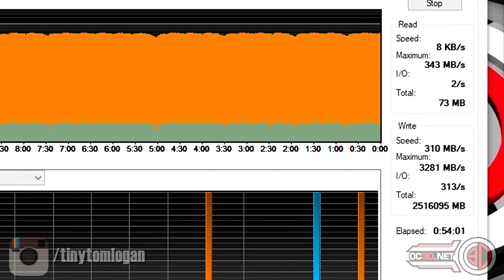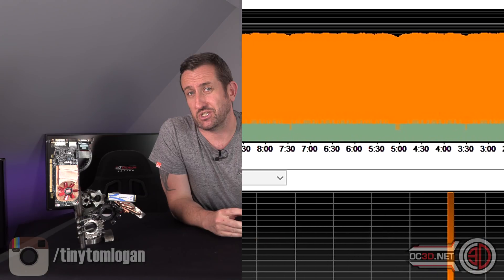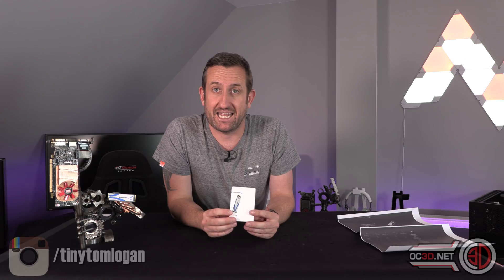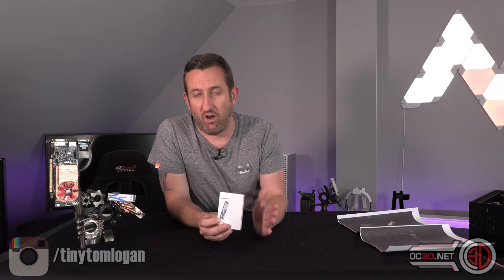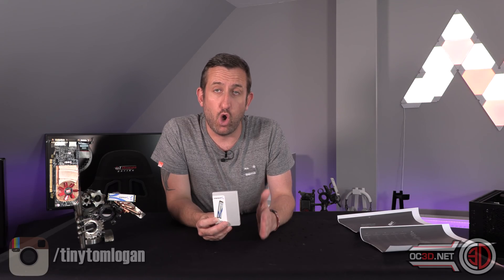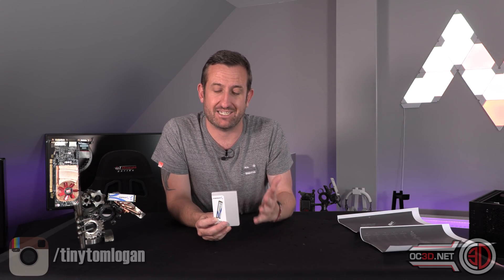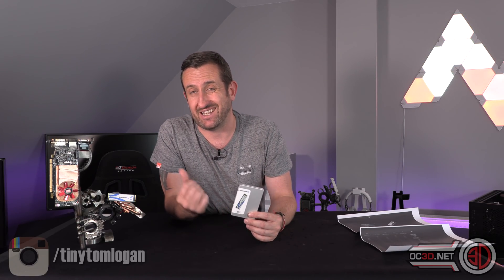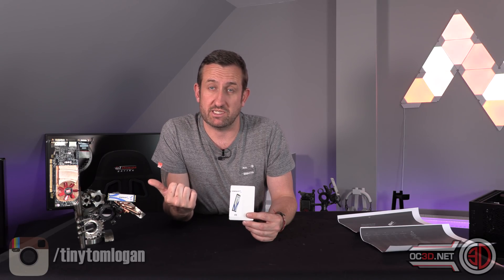At that point I thought I'd found the limit of the cache, but I let it push through because I hadn't got to that two-terabyte marker yet. And then pretty much spot on at two terabytes, the speed dropped yet again. Around that point it was floating somewhere between 350 and 500 MB/s — more around the 350–400 mark than anything else, though we did see times when it was going up to 500 MB/s. Now I know some people are going to say it's slower than SATA SSD speed, but you do need to remember that at that point it had had a single file of over two terabytes written to it — completely pushing past all that SLC cache.